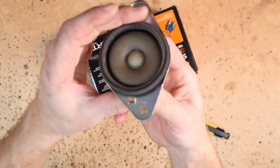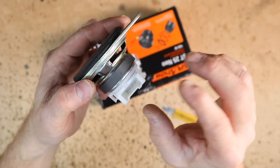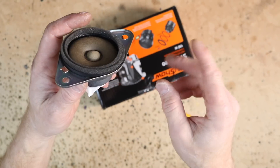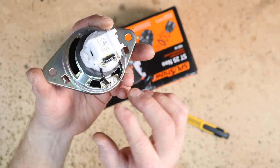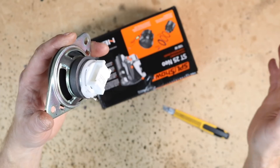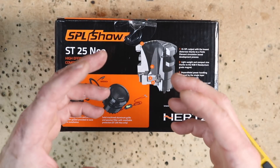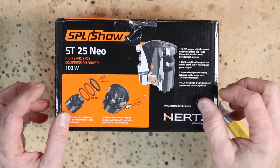When removing the trim handles the seam is very tight. We use a metal panel tool — it's really thin on the top and you can buy them at mobilesolutions.com. It fits right into the gap and easily pops the panel off. Most bolts in this car are 10 millimeter. At the bench, here's the factory dash speaker — a paper cone with a standard magnet and a pass-through clip on the back. The signal comes from the radio, passes through this clip, and goes on into the driver's door. The replacement is the Hertz ST25 Neo — this takes the Mille Pro's musical quality to a whole other level.